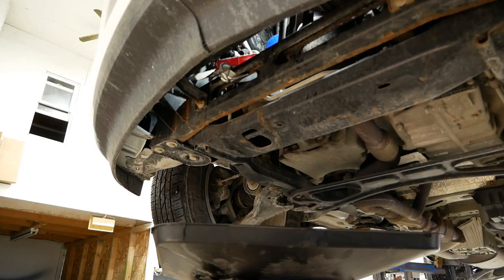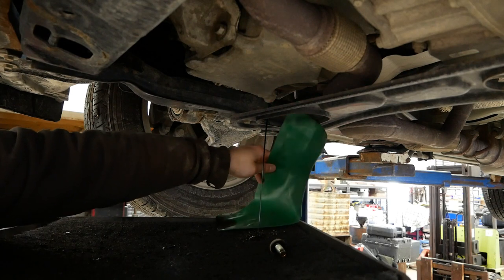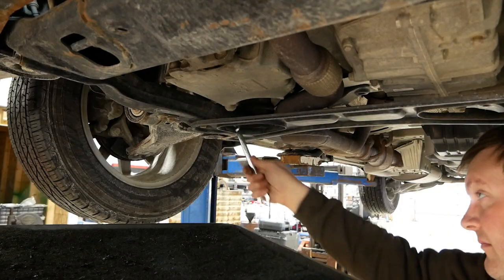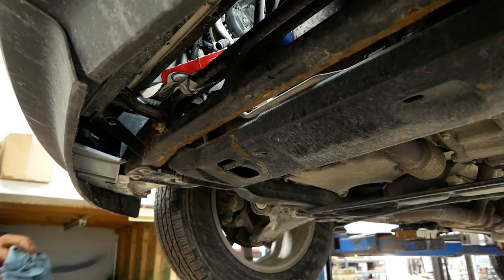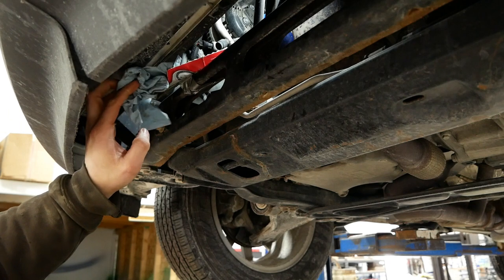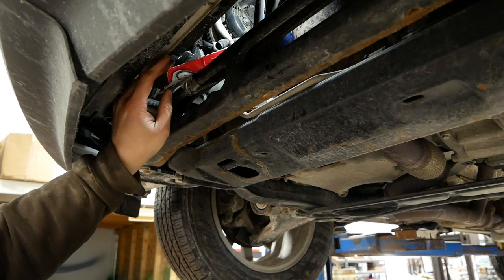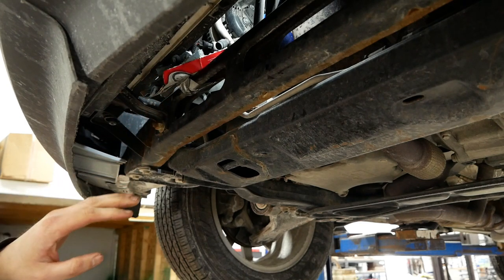So that's the trick. We just let the oil drain out of the filter and into the oil drain pan and our life will be a whole lot easier. The Forma funnel also makes a nice deflector. Alright, we're done underneath. We're going to go ahead and leave the tray right where it is. We're just going to stick a rag kind of inside of it so no oil spills out on the floor.